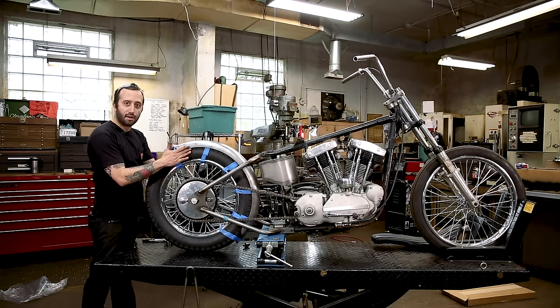And you even have a little bit of play with how long the bung is in case you wanna do something a little different. So this should be a pretty easy bracket for you to use to mount your fender in the low spot. So I'm gonna start with showing you how to drill the holes. First thing we're gonna have to do is get some things out of the way. So let's do that now.